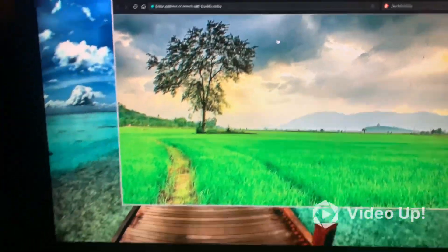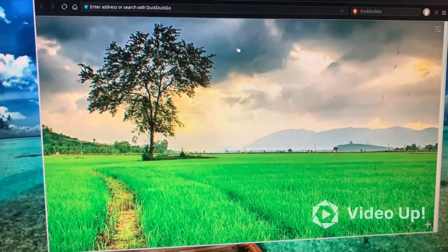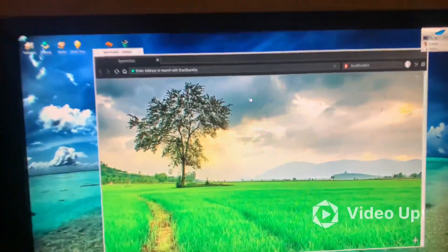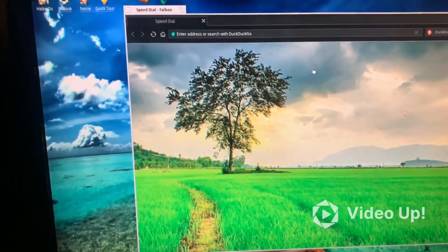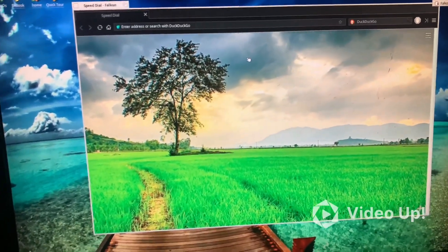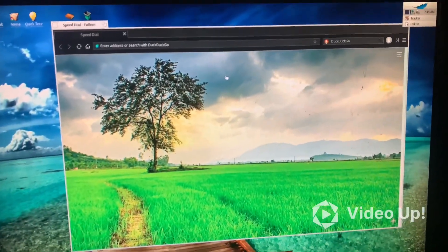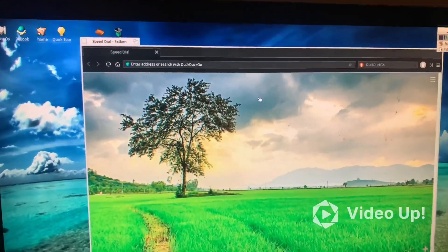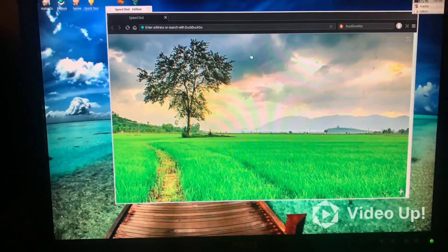I'm going to try out a WiFi card — it's an M.2, I've got an adapter. It's an Intel 7265 or something like that. I'll give an update on whether it works out of the box. I like the basic design — very slim. The whole OS installation is only one and a half gigabytes on the disk. Free applications, music, internet, and sound all work out of the box. You do have to add a video card because the CPU's onboard video does not work. But it works on actual hardware. You can't even tell this is an old school hard drive — you'd think it's on a cheap SSD. Alright, see y'all later — thank you for watching!